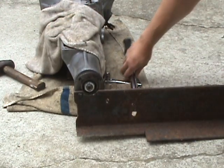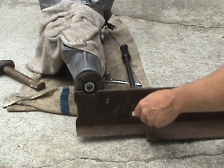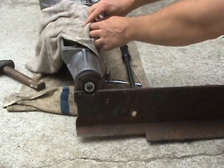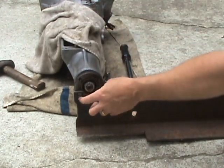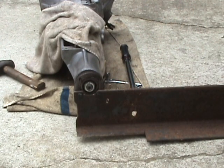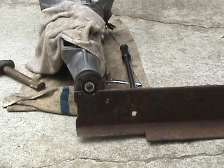And you can see my setup, same as how we took it off. This is a different one. I've got a piece of angle iron here, heavier duty than that aluminum piece I had earlier to take the nut off. But the same thing. I just cut it out, drill some holes on it, and that's all there is to torquing down the outside flange nut. And that should do it for that guy.